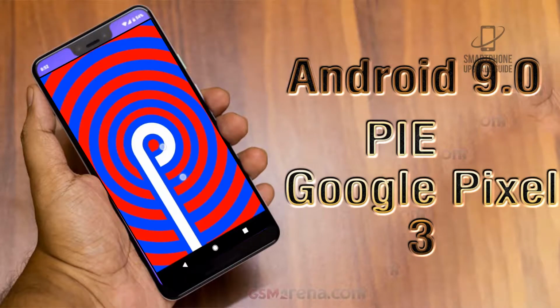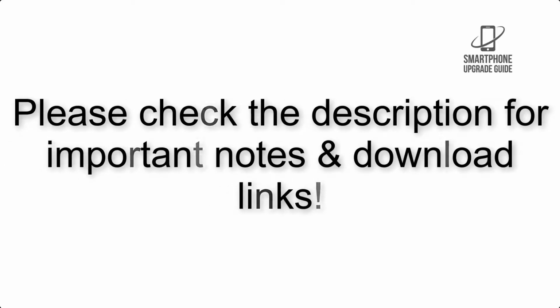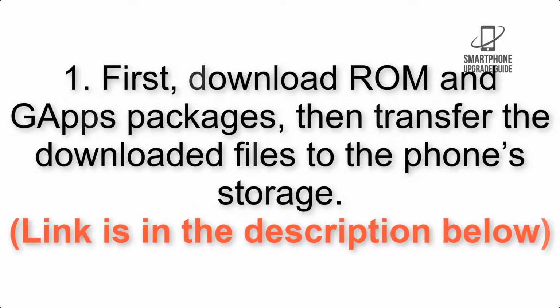Install Android 9.0 Pie on Google Pixel 3 via LineageOS 16. Please check the description for important notes and all the download links. First, download the ROM and GApps packages, then transfer the downloaded files to the phone storage. The link is in the description below.